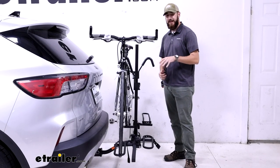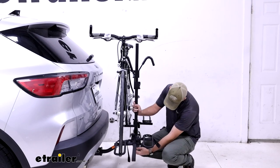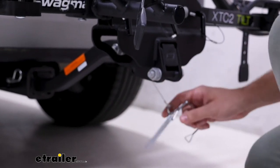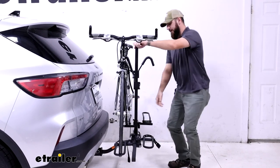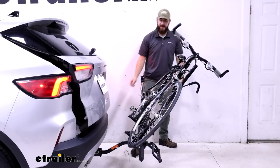As the name implies, this bike rack can tilt with the bikes loaded. However, it's a little more cumbersome than some. It's going to be a pin and clip down here on the bottom — pop that clip off the pin, put some pressure up to get the rack tilted — then you can lean it back so that way you gain access to your cargo area and can open your hatch.